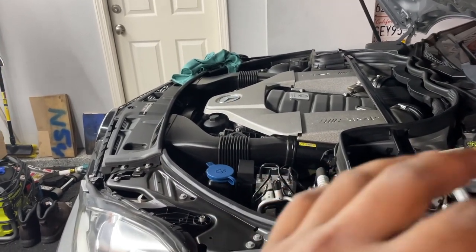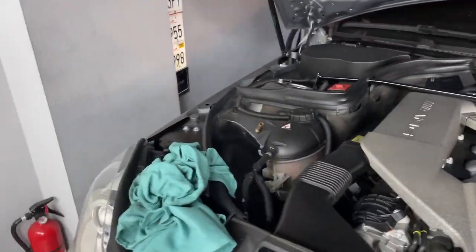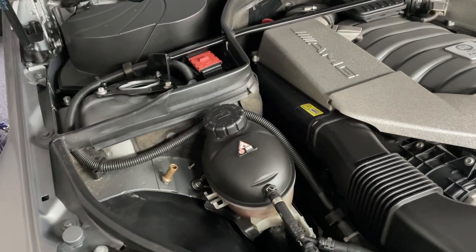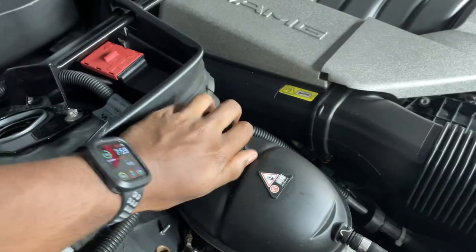Before working on your cooling system, make sure it's very cold and not warm. A warm or hot cooling system will be very volatile when you open up the cap — it could explode in your face, and you really don't want that. So wait for it to cool down. My car is actually cold right now since it hasn't been started in a while, so it won't be hot at all when you open the cap.